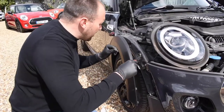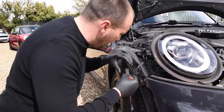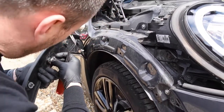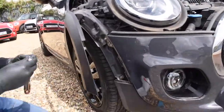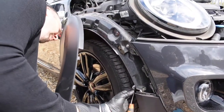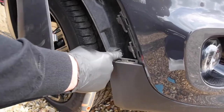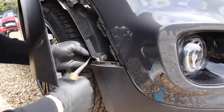You will need one of these - it's just going to help you get these little bits of trim out so we can pop them back in. Give them a little hug and they'll come on their way. We've got one bolt down here - one nut which is an 8mm socket - which connects the bumper to the wheel arch. So we're just going to whip this one out.